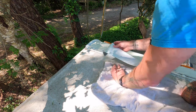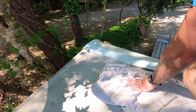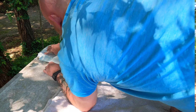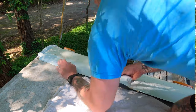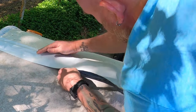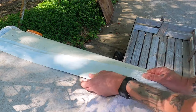When working with Eternabond, keep in mind it is incredibly sticky — that's why it's called Eternabond. It is incredibly sticky, so you want to go slow and steady, peel it back a little bit at a time and press in as you go. You can use a credit card to slide it in place, but I just use my fingers. It's really malleable and the roof has a nice soft surface, so I can press it in with my fingers and run them along any seams. Definitely go slow — don't peel off all the backing for a ten-foot strip at once, because you'll end up tangled and in trouble.